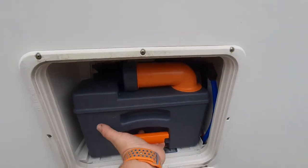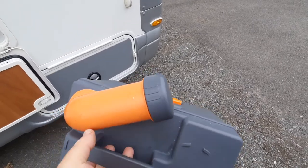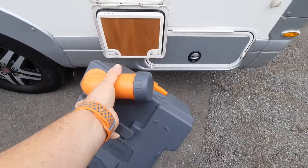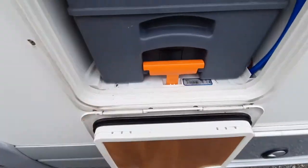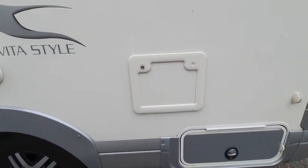You do have a spare set. Lift up the toilet cassette, turn it round, undo the grey top by unscrewing it, press the orange button at the bottom, turn it upside down and empty it out, clean it out. Put your chemicals inside, slide it back in, and make sure the handle locates in that little lip. You do need to have the toilet valve closed to operate that.